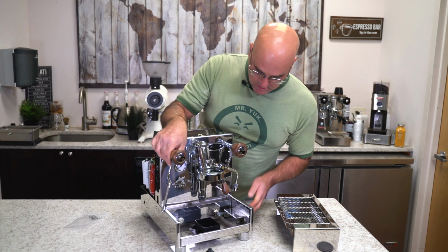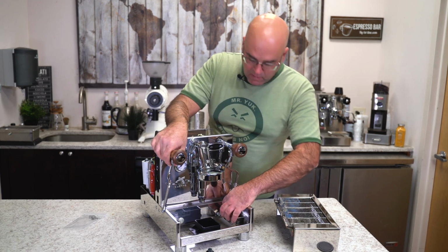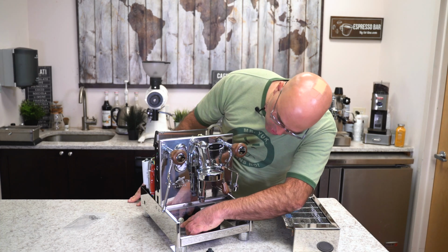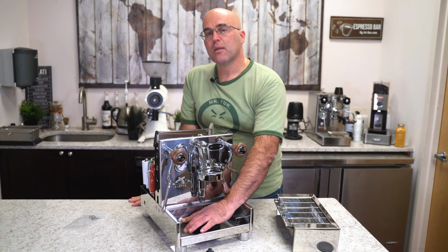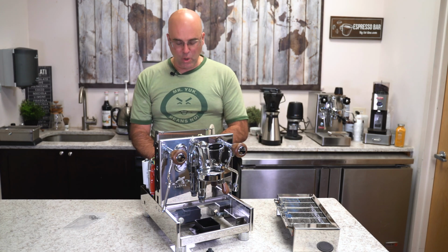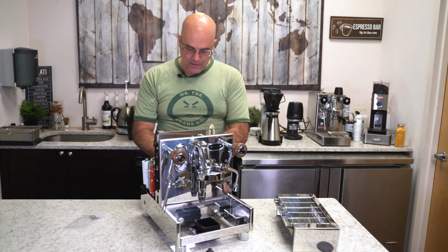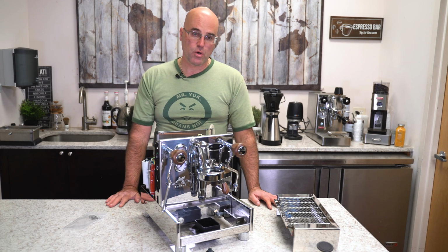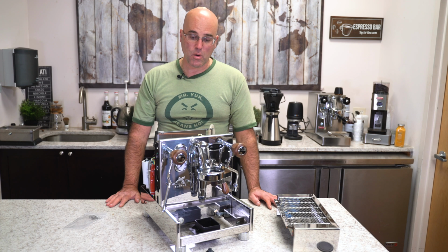And you might be hard here to see this. There's a lever to go from plumbing mode to tank mode and vice versa. And also a switch here. This particular switch is to basically shut off the low water level sensor, okay? And there's no switch under here. There's a magnetic float that goes in here to turn it off when the water level's low.